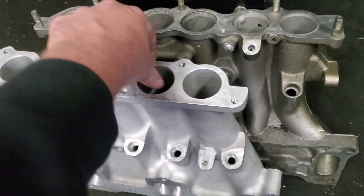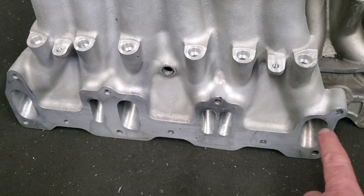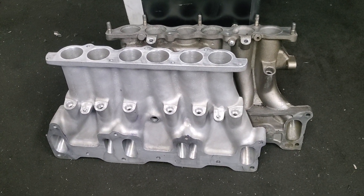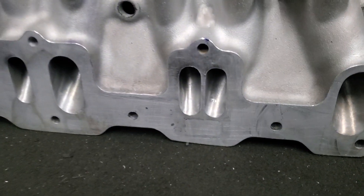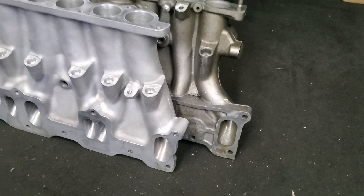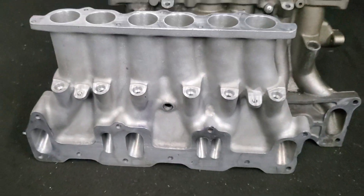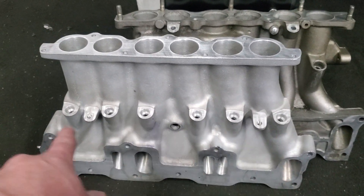The casting is at least OEM quality. I did do some cleanup porting on it. The intake-to-engine side was actually a little small — I think they based it off of FD3S runners, which lends itself to diverse applications. But in my case, we use the Cosmo ports, a taller port configuration. So I did some quick porting and opened those up to get essentially the same airflow we were getting on the bottom half as the OEM. But the main reasons I got it are the equal length runners and the additional fuel distribution.